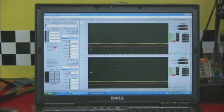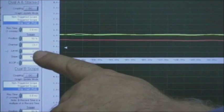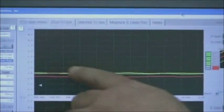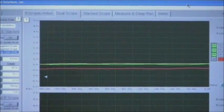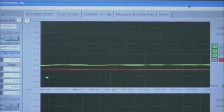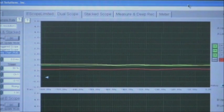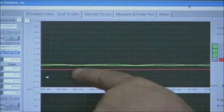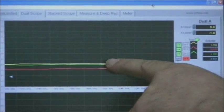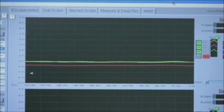What we see here is we're at a half an amp on pressure control solenoid B — the B is at a half an amp. All we're going to do is go from park to reverse to neutral to drive, and it'll always stay at a half an amp throughout those ranges. So we're never going to see pressure control solenoid B change — that's the red line. Up here at 1 amp, we're seeing pressure control solenoid A, which is the yellow wire, and pressure control solenoid C, which is the green wire. When we go to reverse, we're going to see this green wire go to 0 amps, which is what's going to put the direct clutches on and seat that bathtub check ball.